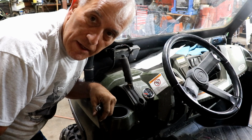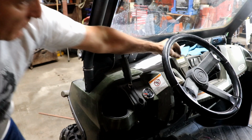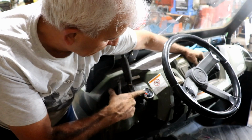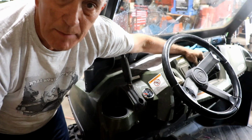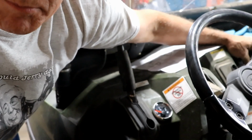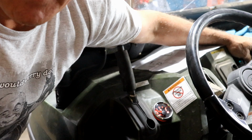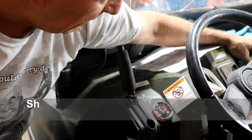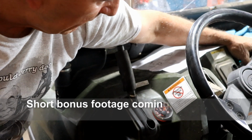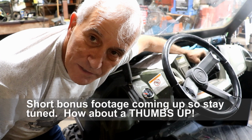Well, my friends, I think I'm going to call it done on this video. Let's just turn it on one more time, make sure it's still working. Watch for the light to come on here and watch for the needle to move. Maybe you can see it. I'll zoom it in a little bit. There goes the needle, and then it comes back up to 3/4 tank. And the light is still on. Well, I'm really liking that because it's been a pain not having a good gas gauge.